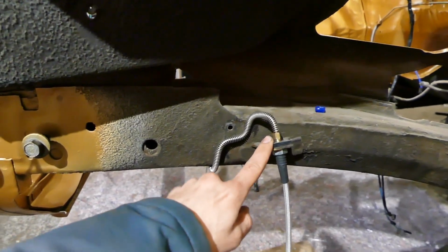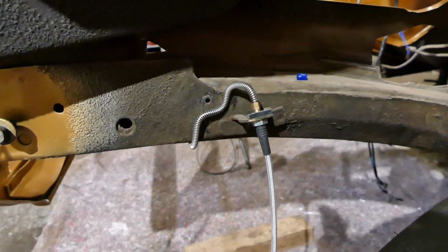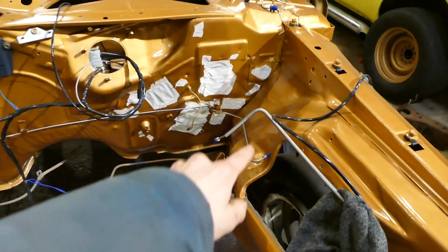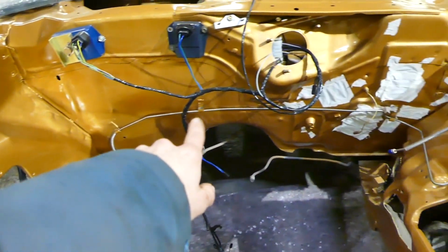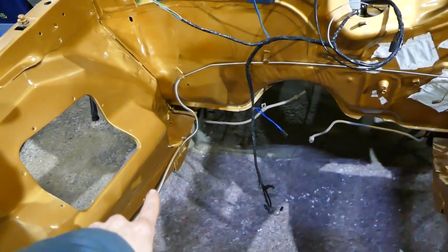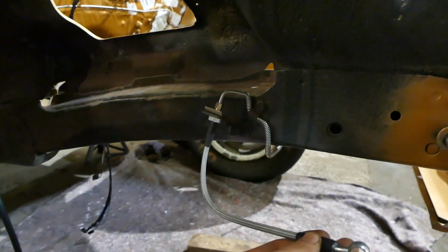And then of course, I don't think I showed it, but I told you guys that I got a brake line kit from Classic Car Industries. So the first line I got run down here on the brake lines, clips on the firewall, and then it goes down here to another clip, and then I'm missing a clip for that hole right there. Runs over here, bends under the frame, and then runs out under the frame and out here to another braided brake line. So that's real nice.